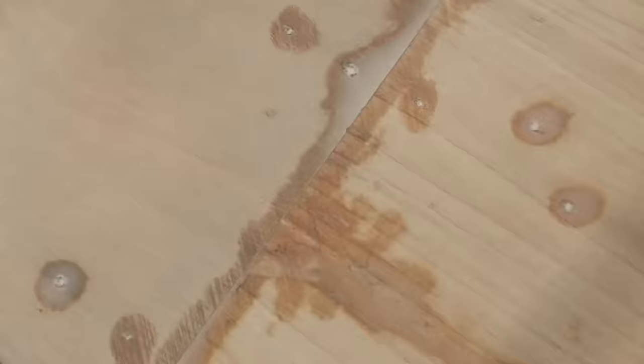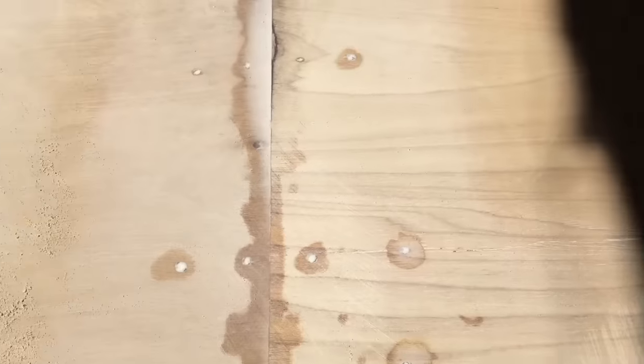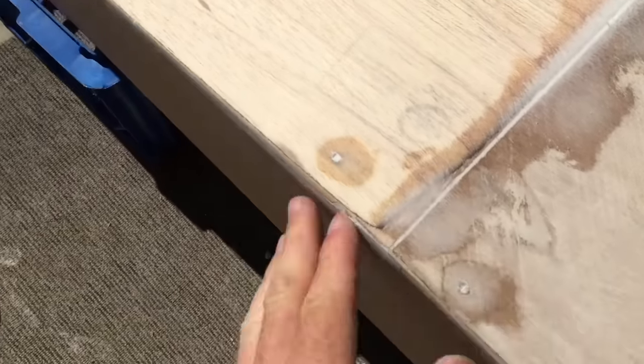Just finished the hull, it's extremely hot, and then blow vac'd it all so I could see it. Can't see any blemishes, which is good. Perfectly smooth, that's what you want it all the way down to. So it doesn't look like I'm gonna have to re-bog. So my theory of just fill it right up so you don't have to re-bog later worked.